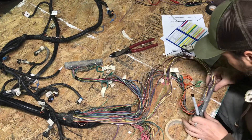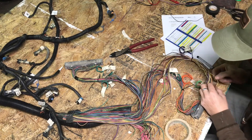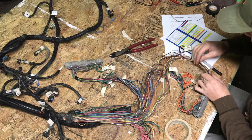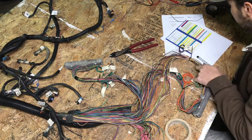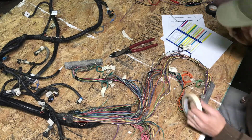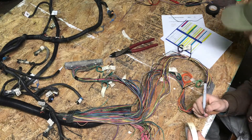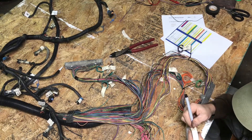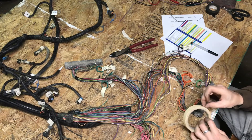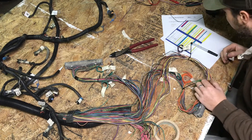Pin 71 — mine does not have it, so we keep moving. Pin 72 is a yellow wire and that is for our park neutral safety switch stuff again. Like I said, with this stuff I'm not going to de-pin, snip, or anything — I'm just going to leave it be for now and label it. PRNDL B — identified and labeled. That was pin 72.